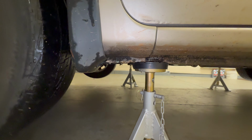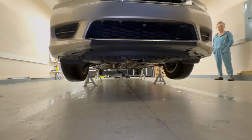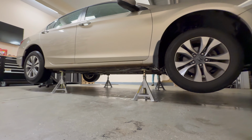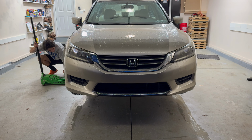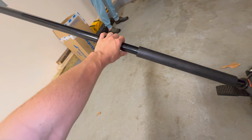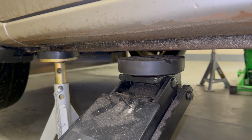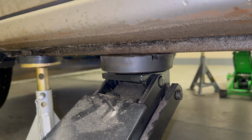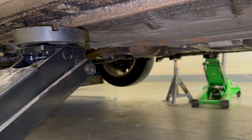I was getting under the front to do an oil change and was jacking up the whole vehicle to make sure the engine is level and all of the oil drains. Since I have 2 jacks, I put extra backup jacks under the front welds, barely touching if at all, the weak welds close to the strong pinch welds. This could mess up the vehicle if supporting from these points, but I would rather the car falls onto the jacks than myself if the front jack stands fail.